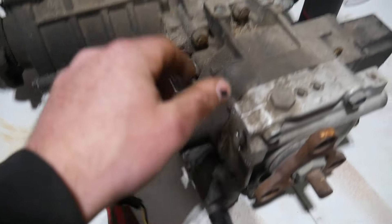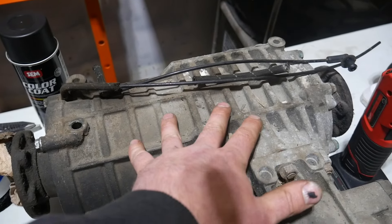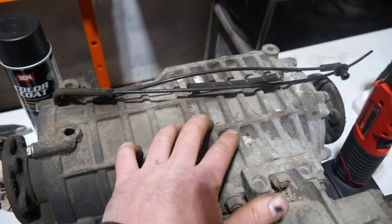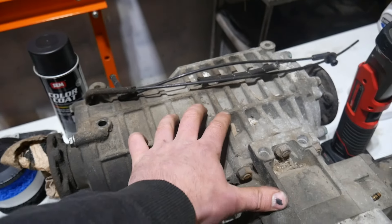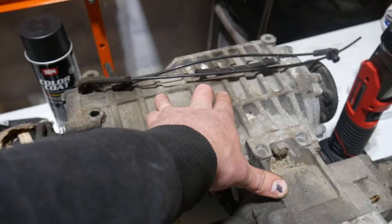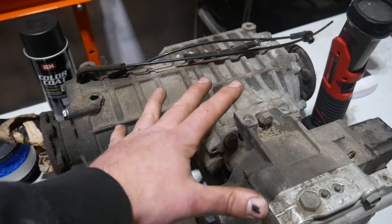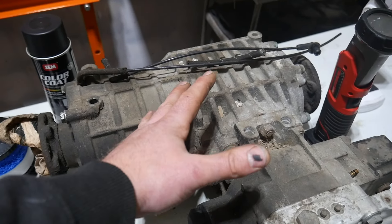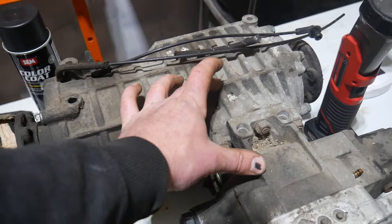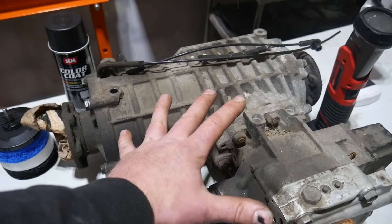When this activates the little motor and engages these clutch packs, back here is where your gear oil is, and that's what's going to lock up our rear end. My plan is to take this apart, get the rear gears welded so that we have a welded diff, and then put it into the Audi. I got this one as a spare parts unit in case we break something. I do not know how much abuse these clutch packs are going to be able to take, so it's going to be a learning process — that's why I got a spare one.